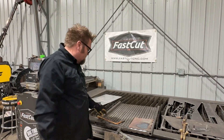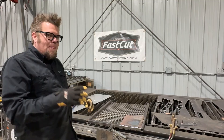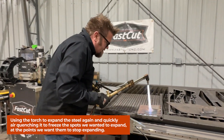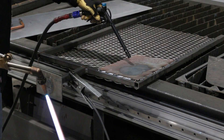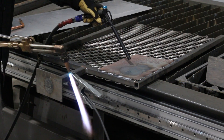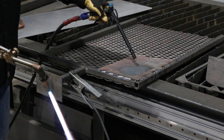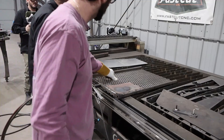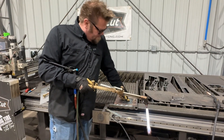It'll actually be in the panel the whole time. The way you fix that is you actually start heating this metal in very specific spots and then basically quenching it with compressed air, and it'll actually cause the metal to shrink. You just want to give it just a little bit of heat and then immediately cool it.